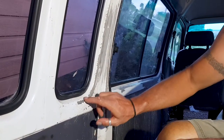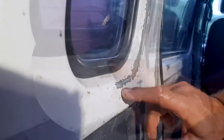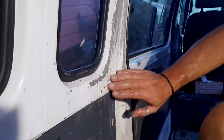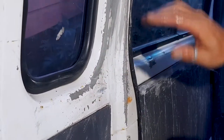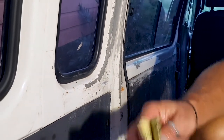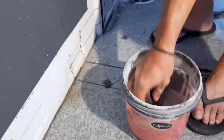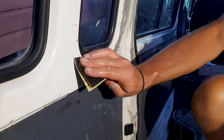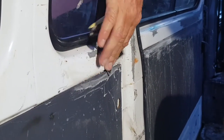Our first step of this transformation is to just basically tidy up the inside here — wet rubbing. You can see where all the paint has been chipped away on the edges here; that's what we've got to sand back. Now you don't have to sand it back to metal — I'm trying to just sand it back to the undercoat. Sometimes you'll go through the undercoat but it doesn't really matter. The name of the game is just to get it smoothed. So you get your wet rub, your wet paper, just have a bucket of water going, dump your paper in there so it gets wet, and you just rub it.